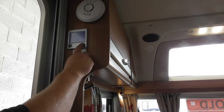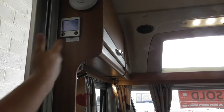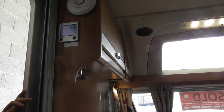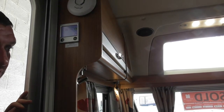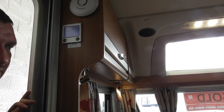Okay, but all you need to do, if you are on there, you can set, as I've shown you, an amp limit in there, plus or minus it, and it will stop the heating system from overloading it. So what it mainly does is, say you flick a kettle on, it will switch the heating off while that kettle's boiling. When the kettle's finished boiling, it will resume its normal order. So it just saves you having to go outside every 2 minutes to redo the switch.